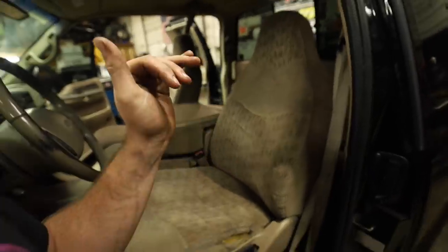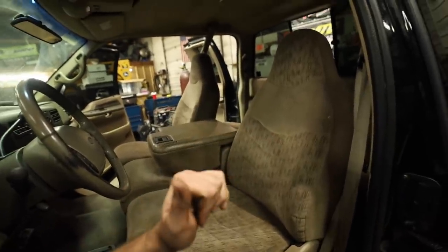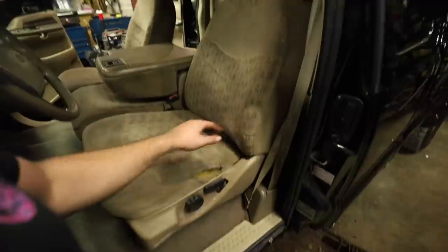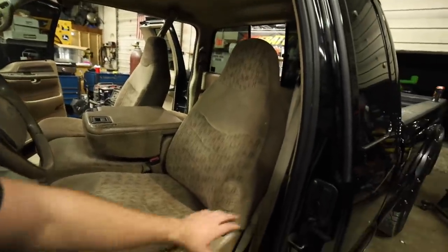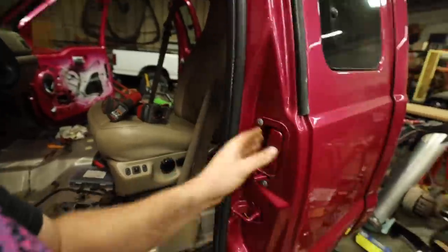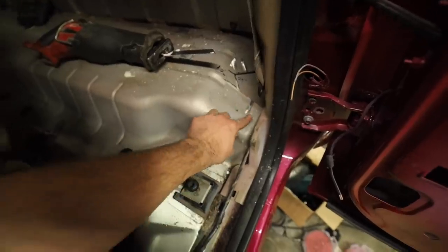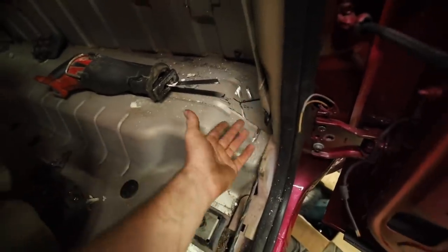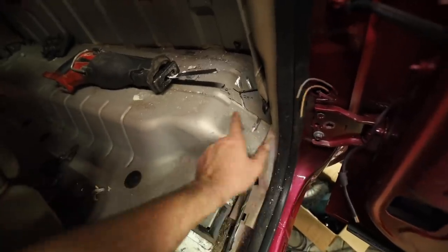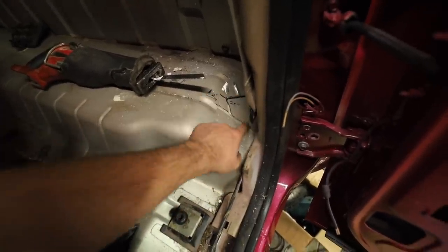I will say that I got a different mini belt sander trying to get those spot welds out. It was just super thick metal. It wasn't like rocker panels or body parts. That seat bracket metal was super thick. We got all the ones out of the black truck by drilling and grinding, but these, we would have been here all day. These spot welds would just be a pain to get out and then get the bracket flat and all that. So just doing this saved us time and ended up giving us a more secure mount.